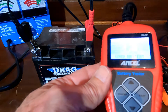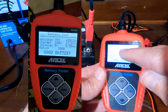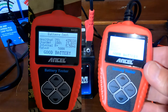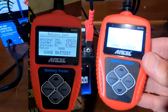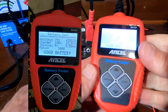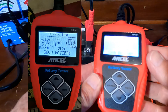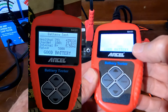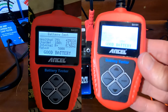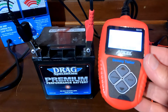It says it's a good battery — it says it's healthy. It's at 75% of its cold cranking amps, which is getting to be pretty borderline, which is why I was seeing the delay when I'd go to start the bike — it would turn over, then pause, then turn over again. Charge is 100%, 13.01 volts, which is very similar to what we got on the Klein. Internal resistance: 5.8 milliohm. It says it's a good battery, and it was still working — but I like to replace them before they go bad. These things are real slick and very cheap — I think I paid maybe $25 for this on Amazon.